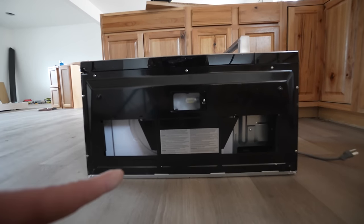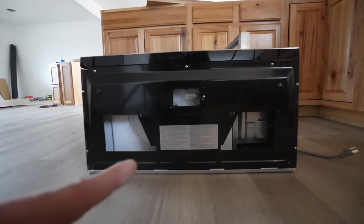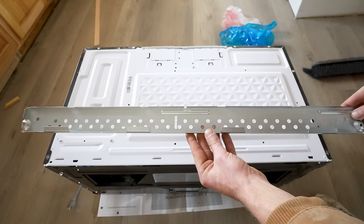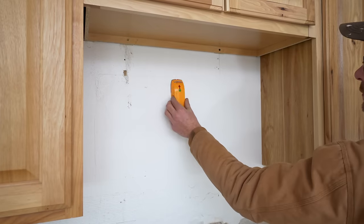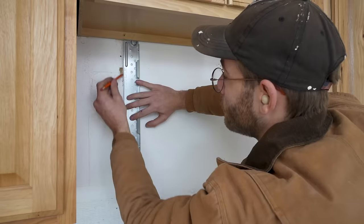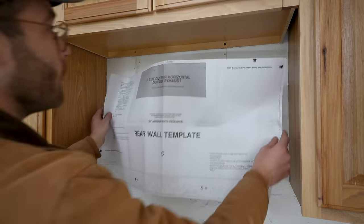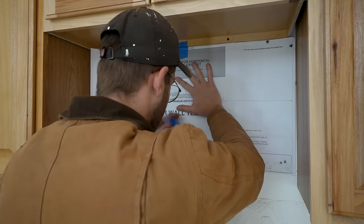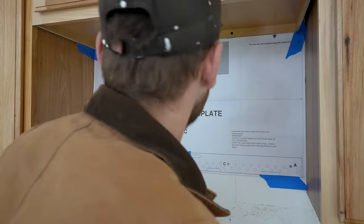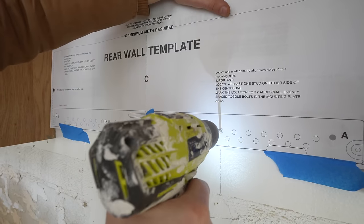There are lights on the bottom and the vents for the range hood right here. Typically the mounting bracket that goes on your wall will be attached to the microwave for shipping. After I removed mine, I grabbed a stud finder to mark the locations of the 2x4 studs behind the drywall. All microwaves should come with a template to mark the locations of your hardware and the holes that you'll need to cut, either for a wall mounted duct or a ceiling mounted one.